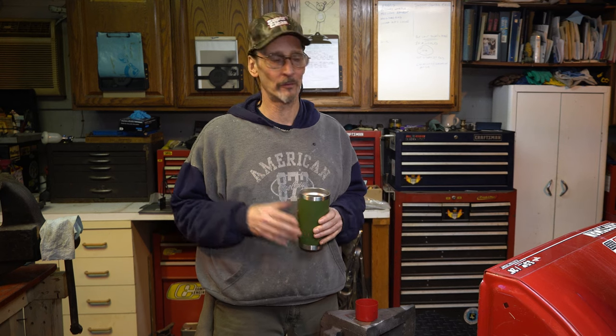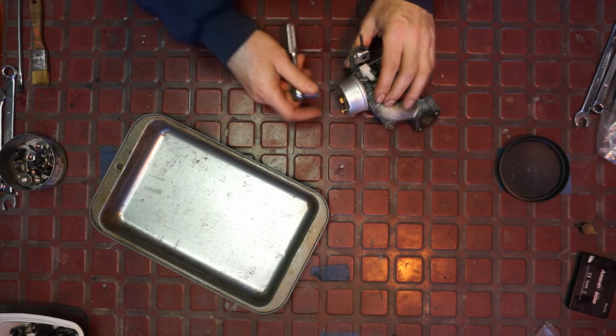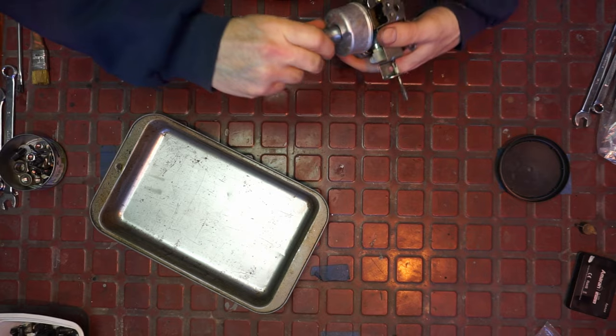You may not see it for a long time. Most of the time you'd think it's a carburetor issue, and on both of these machines they both had carburetor issues. On this machine I went through three carburetors trying to see what I could do — I had to kind of make one from different pieces. I sorted that out, so it has nothing to do with the carburetor or the fuel system. This problem is an ignition system issue, and we're going to go in and fix it.